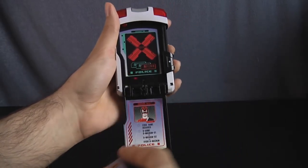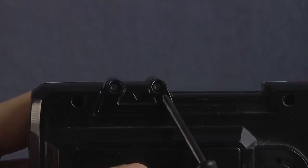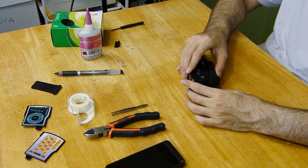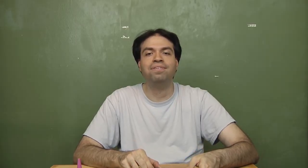Then remove any batteries. Next, open the lid, then take out the judgment and phone panels. Remove the two screws on the slider first. If this is the first time these screws are being touched, you'll hear the varnish crack. The best thing to do is to slightly tighten the screws until you hear the plastic click, then unscrew them. All the outer screws are the same size, but if you want to put the screws back the way they were, just put the slider screws with the slider back piece to remember them. After all eight screws are out, pull on the back to lift it off the front end. All the stuff on the back is screwed on, so leave the front on the table to avoid parts falling out. At this stage, take photos of both halves so you can look back if you forget how stuff goes in. The springs for the lid are built inside, so you don't have to worry about those ones.